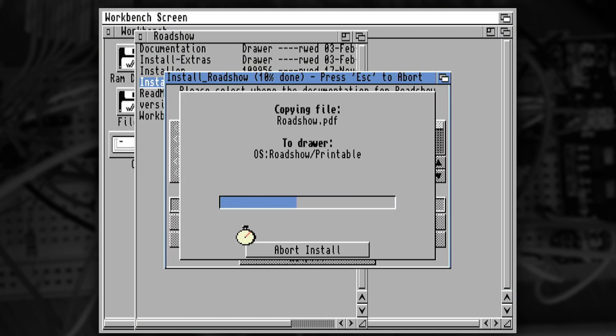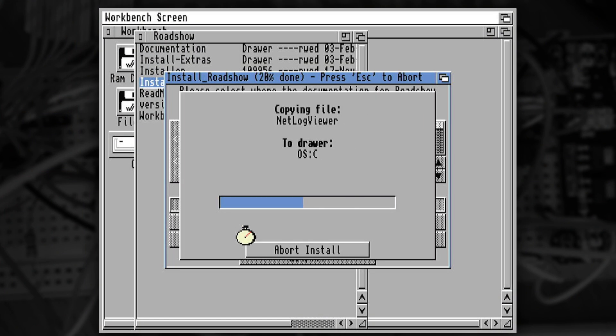To use the internet on an Amiga you need a TCP/IP stack. Back in the old days you had to add these separately — they didn't come with the operating system. Even Windows required you to add a third-party one. I'm installing a full copy of Roadshow here for my TCP stack as I find it the easiest to use, and it's also still being maintained. With that installed, let's get the Plipbox connected and powered up.